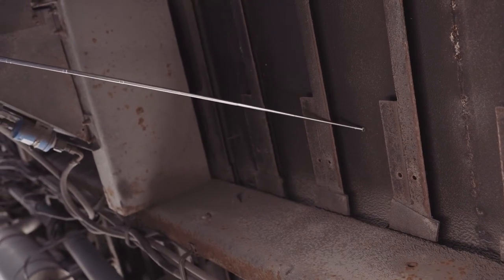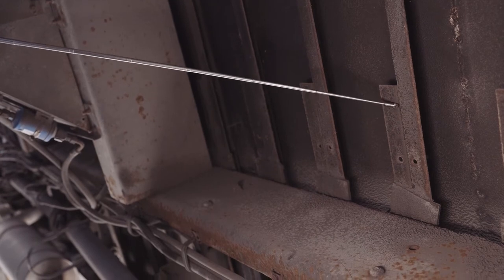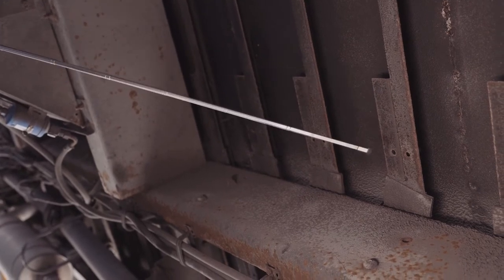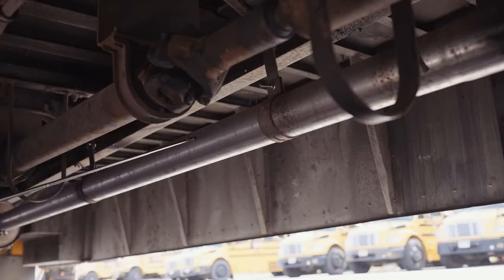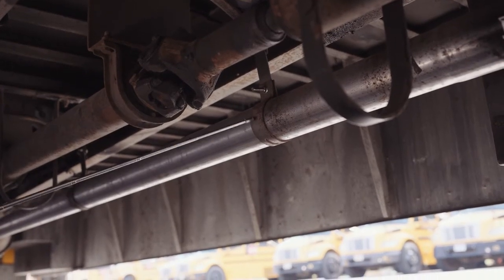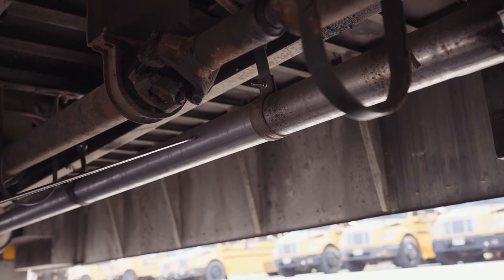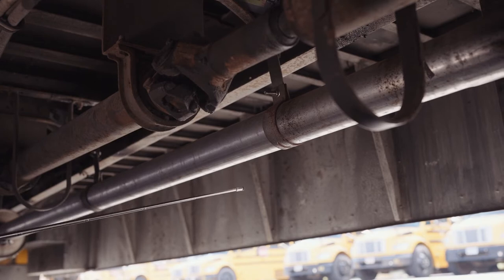My cross beams and flooring are securely mounted. It's not missing any nuts, bolts, or screws. It's not dented or bent, chipped, cracked, or broken, and there's no holes in my flooring. My exhaust system is securely mounted with its hangers. It's not missing any nuts, bolts, or screws. It's not dented or bent, chipped, cracked, or broken, and there's no soot to indicate leaking.